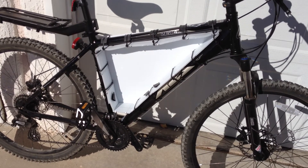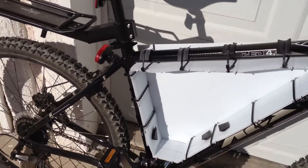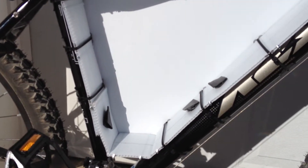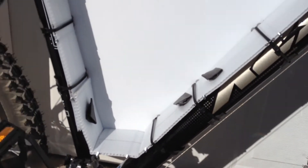I'm converting this Z4.6 K2 mountain bike to electric drive. This is the battery case I'm going to use to mount the lithium ion batteries. It's made out of coroplast, which is a pretty stiff corrugated plastic material. I held it onto the central spine.